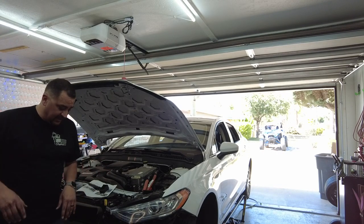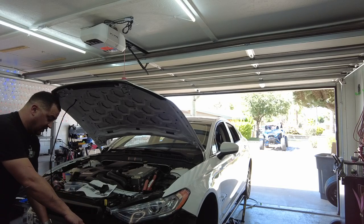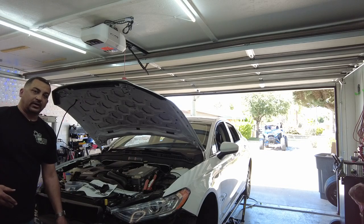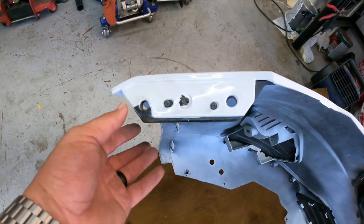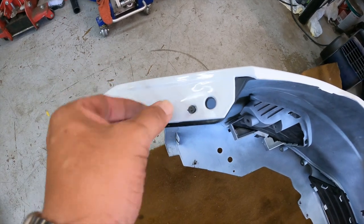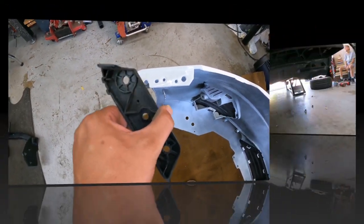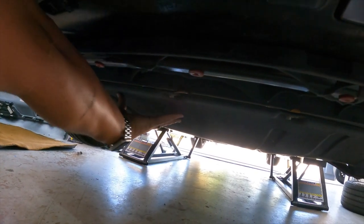I did take this piece off the inside of the bumper — I removed it because the wiring is taped to it. It was four seven-millimeter screws, but you don't have to do that — you can just remove the wiring. There were some clips on the bumper with those eight-millimeter screws. Here's the side of the bumper — you have the two eight-millimeter bolts here, two aligning pins, and one Christmas tree clip. I got some new ones of those, so I'll replace those before going back in. This is the bracket you're removing. The next step is going to be removing these five 10-millimeters across to drop this front area down.